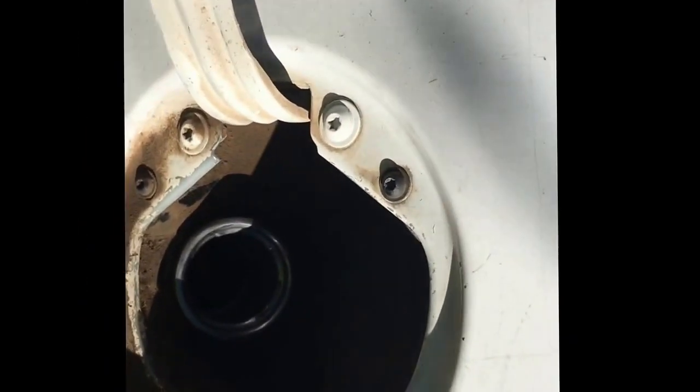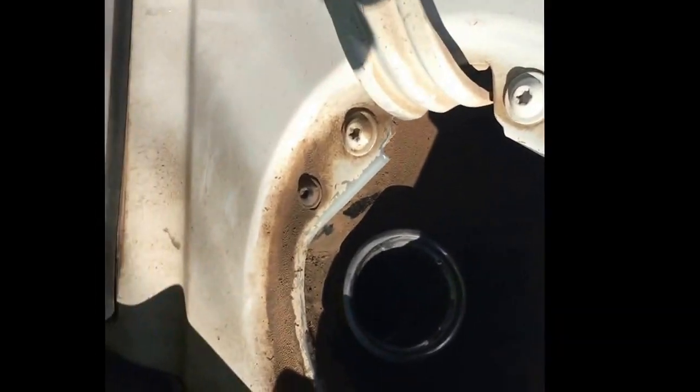Lost my fuel pressure and I suspect I have a bad line, a cracked line, kind of a Dodge Cummins thing. So I have a kit I bought from Diesel Bombers for a new hose kit. I'm gonna start with putting that in and hopefully that fixes it.